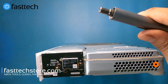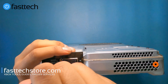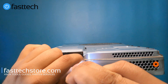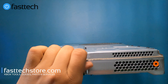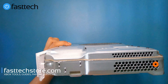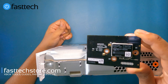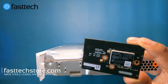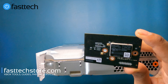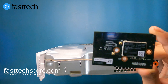We're going to switch to a T8 bit from our FastTech Pro Auto Kit and remove these T8 screws. We're going to lift the network card up, and at this point you can replace the network card if you need to. Some of the reasons you might want to do that: if your Xbox One S is not picking up signals from your controller, or if it's not showing any Wi-Fi connections, you might have to replace this network adapter. We sell these on our website — links in the description box.